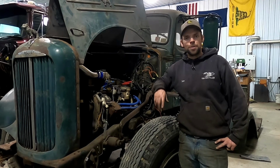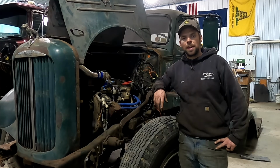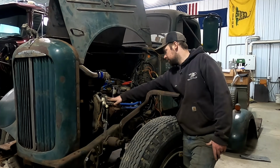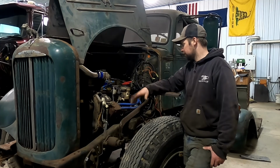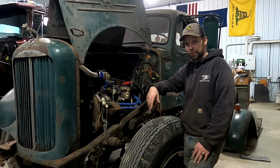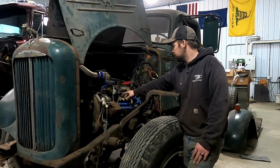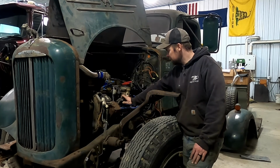Unfortunately, that's as far as we're going to get tonight. I've got to go home and go to bed. I think what we've got going on is there's a relay that drives the fuel pump, or the injection pump. It's the VP44 relay. And there should be power on 6 and 7 on this plug. Now the problem is I can't really tell what that is.